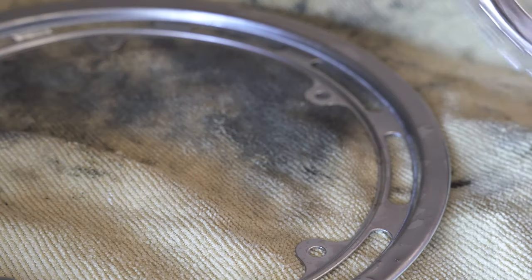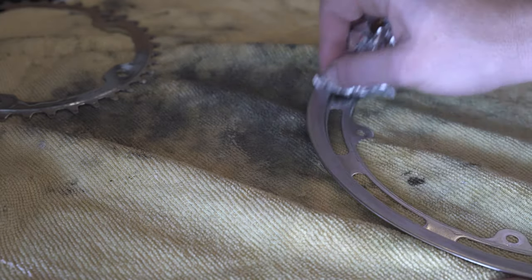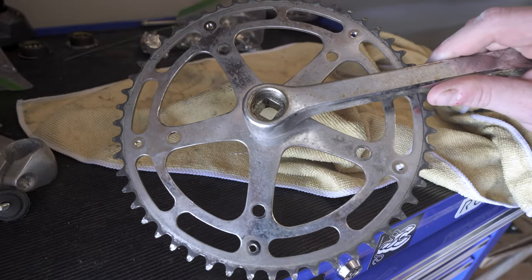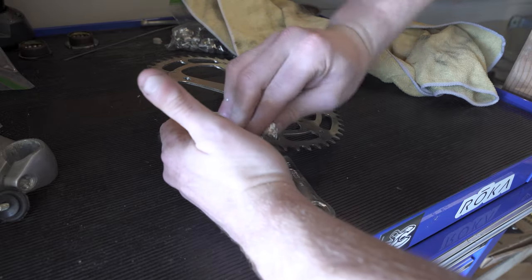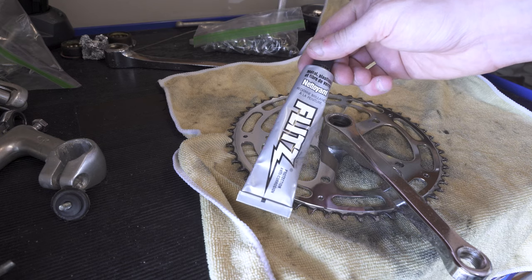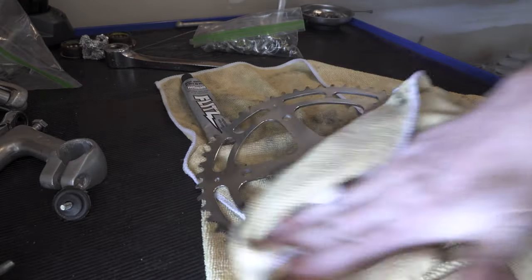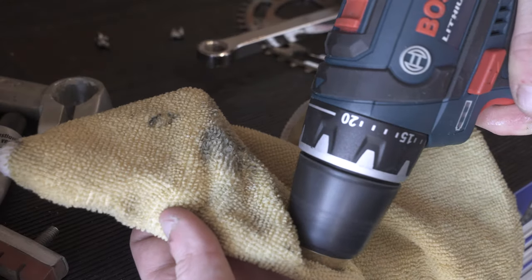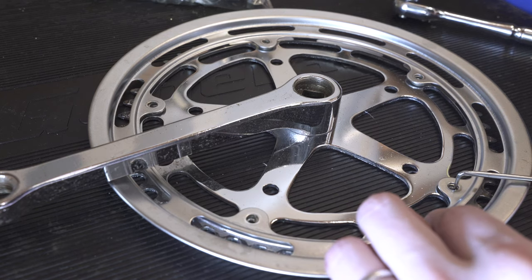There's a little bit of corrosion, but not too bad after the Evaporust — it really cleans things right up. I decided to use the aluminum foil trick on the cranks: you use aluminum foil and water to essentially erase the rust, because rust is softer than aluminum foil and aluminum foil is softer than chrome, so you can literally erase the rust. This Simichrome polish I've used on a few bikes — it's not really a requirement but it really brings the original chrome back. For the nuts and bolts, I throw them in my drill chuck with some aluminum polish and clean them up really easily.